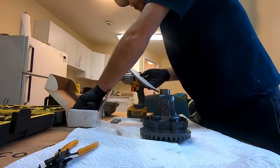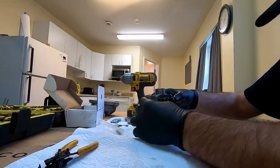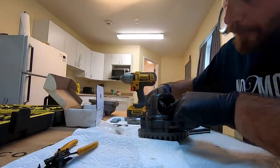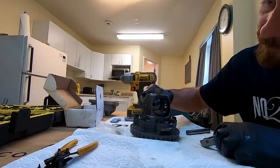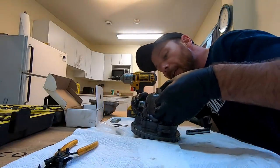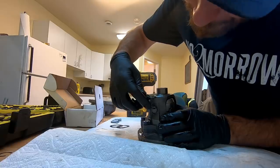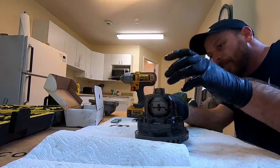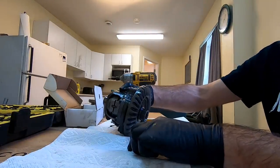Springs. There are shims in here, but in my experience we've never had to use them. We're gonna let all these gears kind of go, pin comes out, just rotate these and they'll usually start falling apart. There are washers in there that got to be removed — one, two. We're gonna go with one of these, and one of these, and we're gonna put our top in and then come in. This side is a nice fit — just like that. Reinstall our pin, spin it around just to ensure it's in that groove. We'll stick the springs in there and then we're gonna measure that gap. That's all there is to it, aside from ripping out the guts of the visco.